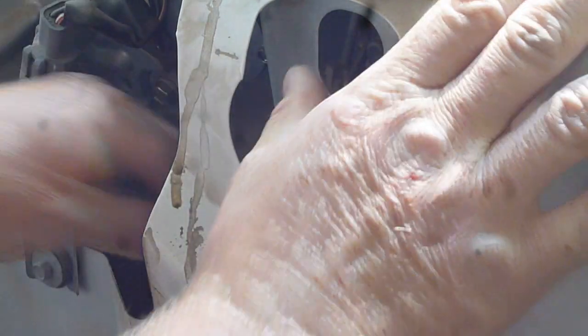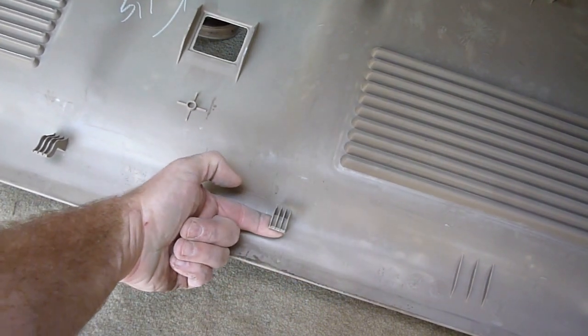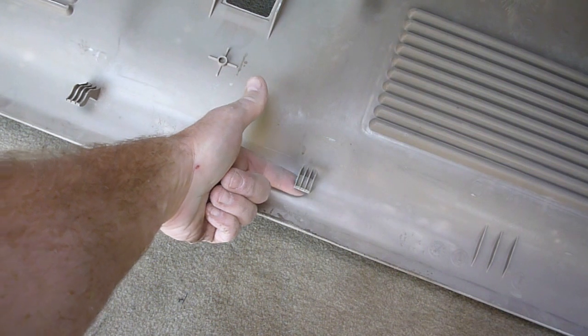I'm going to go across here — sorry about the light, but it's what you get. Then it lifts up, just like the door on the Astrovan — almost identical. I'm going to reach in here and try to get this tailgate open and give you a better look. We see this little yellow clip here and there's also a rod down here, but you can get to it over here. They actually push towards the outside, which lifts up the tailgate. The clips just sit inside of metal cutouts on the inside of the door — you unhook around the top edge and then lift straight up.